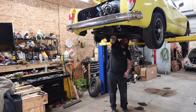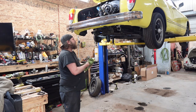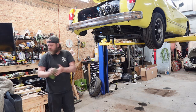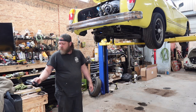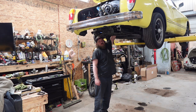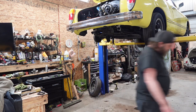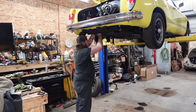What is that? All right. Where I throw the exhaust. I see it. You just come down. Oh, I'm here. Where's the clutch feel like? Cable-wise play. Oh, we got loads of slop. Let me adjust that. Let me get the exhaust done. And there's still plenty of anti-seize from the last time I took this thing apart, so I didn't put more on.